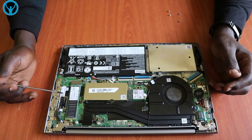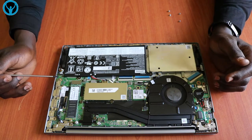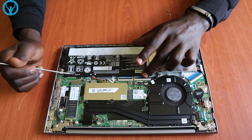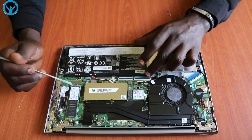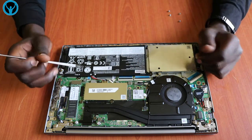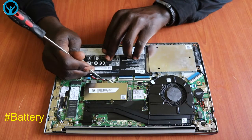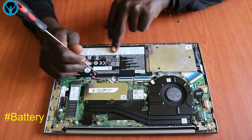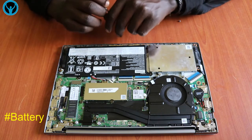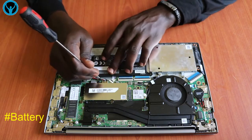This is our bottom cover of the laptop. Now let's focus on the interior and see what is inside here. Looking at the motherboard, it's a pretty good laptop, but remember our best practice is always to first disconnect the power, or rather the battery of the laptop.